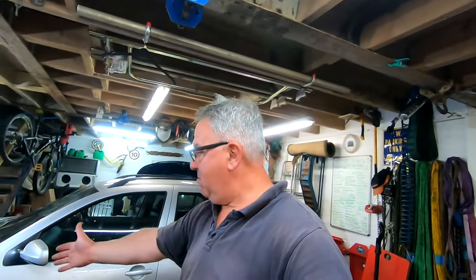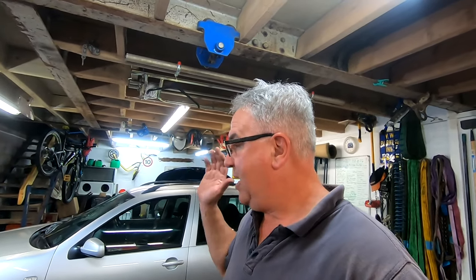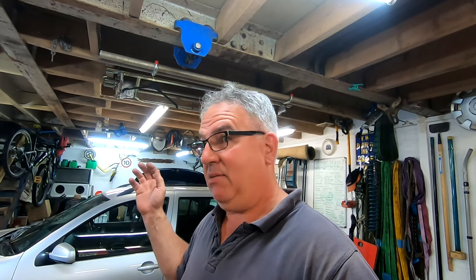Well, that's it, all done and dusted, all back together. I have to go on a test drive, I will do that. But yeah, not too bad a job. Ultimately, undo that bottom ball joint and do that straight away, first thing, makes it easier to get out and possible to get back in. I guess because I was pulling it, it was twisting the outer CV more than I could do by hand and it popped out. But yes, the bottom ball joint's got to come undone, which is not too bad. Yeah, and remember, get that clip that holds the gaiter in the right place, not in the way of the bolt holes. Bit of a rookie error, but every day is a school day, as they say.